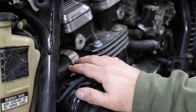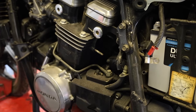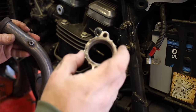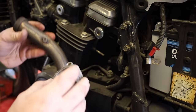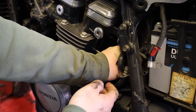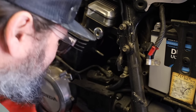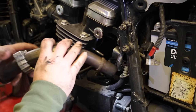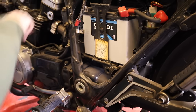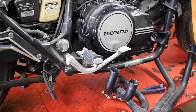I don't want to get this tight yet because we still got to fit everything together, so I'm just going to leave it fingering tight. We did manage to get the exhaust pipe all the way out on this side. Noting that I almost put the wrong collar on there — there are two different collars: two that don't have a countersink for the rear exhaust and two that have a countersink for the front exhaust. The trick ended up being going in from the top, but I also had to disconnect the other side in order to move the heat shield around enough to get in there. So if you're working on one of these at home, that's how you do it.